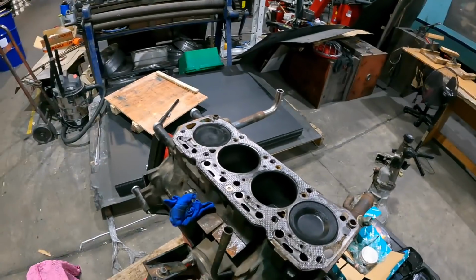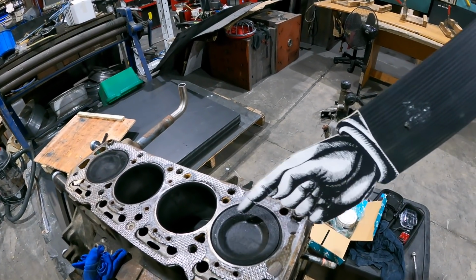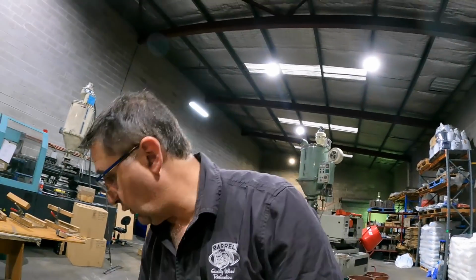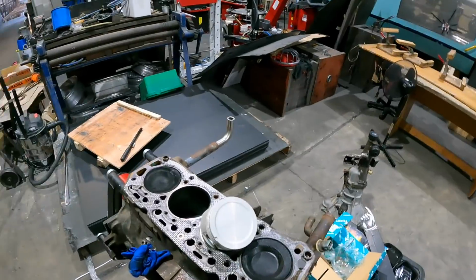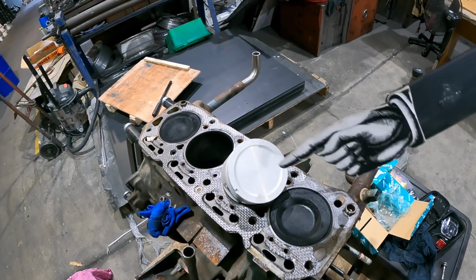Anyway, what he's organised for me is A14 pistons. Now, A15s are known for having low compression, 8.5 to 1 standard, and a big heavy flywheel. Just so you know what I'm talking about, here is our A15 piston. Note the big dish that it has in it. Which is all well and good. Because an A15 is basically just a stroked A14, they have the same bore. So what you do is you get A14 pistons, which are these ones here. Note they don't have the big dish.